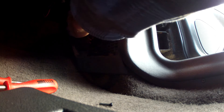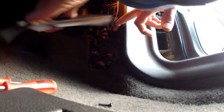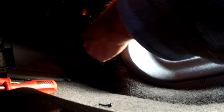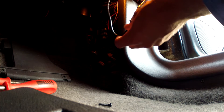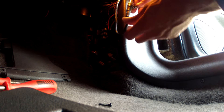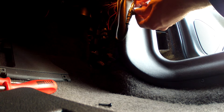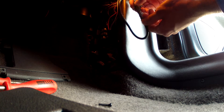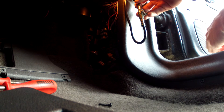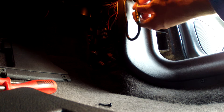Once you get all this stuff out you can take this cover off — push it toward you, take it around all these things and pull it out. Be careful with the old plastic. Then down here you just pull this and there's the connector, which connects the antenna cable going to the radio with the one coming from the antenna. This thing was wrapped in some kind of tape and foam which had all fallen apart, and a little spring inside the connector caused them to split apart — that's why I could never get any signal from any station.